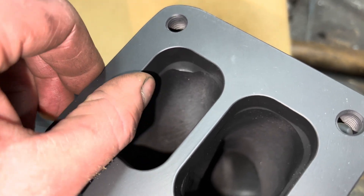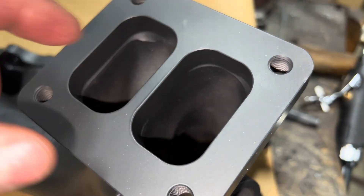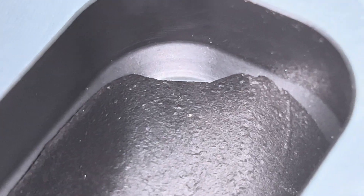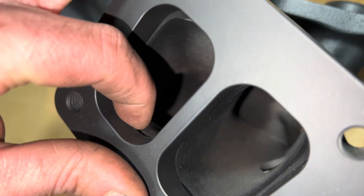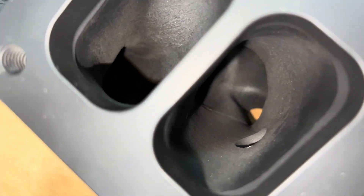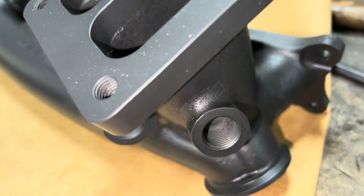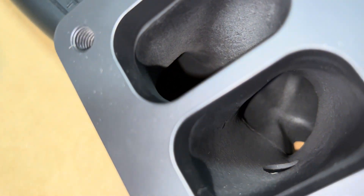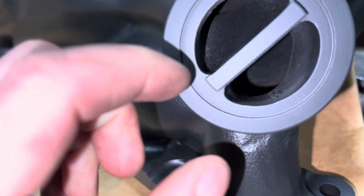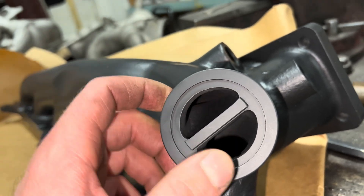What I really like about this manifold is the edges are rounded here and it's CNC ported. But there are a couple edges I want to try and smooth out, like that one, and kind of blend it here. That would be another sharp edge right there where it comes out to the oxygen sensor, so I can try and round that one. There's going to be another one down here I could try and round — this one doesn't really look like it was possibly not done at all. They're a little sharp there so I'm just going to work on rounding those.